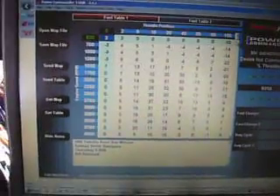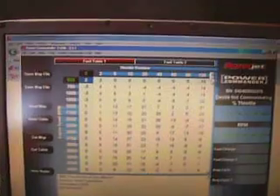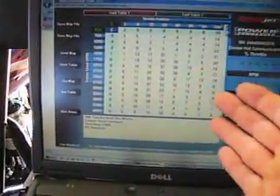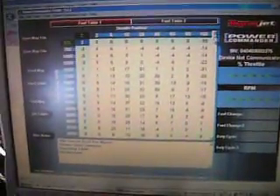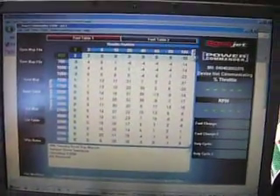The key point to emphasize is that when you lean your air-fuel ratio — as I've just shown on that exhaust gas temperature gauge — when you lean, you raise temperature. NOx (nitrogen oxide) emissions are formed at higher combustion temperatures, so you raise your NOx emissions. It's very important that you not over-lean using your FE device. This is comparable to installing an FE device to interface with your ECM to adjust your O2 sensor signal — essentially doing the same thing, except this bike has no O2 sensor and it's all done by the fuel map. The result is essentially the same: you're changing your air-fuel ratio.